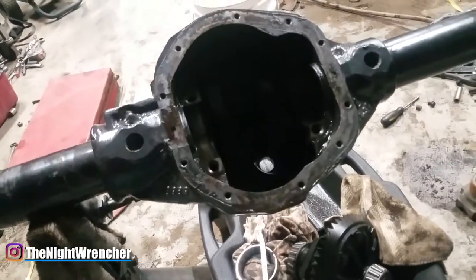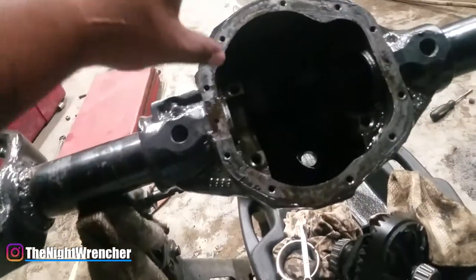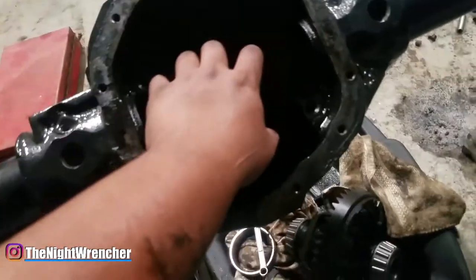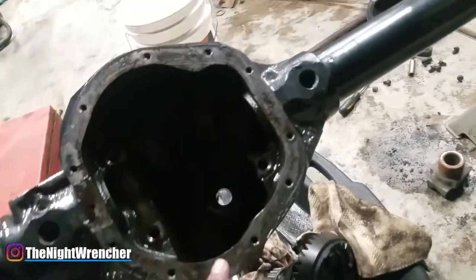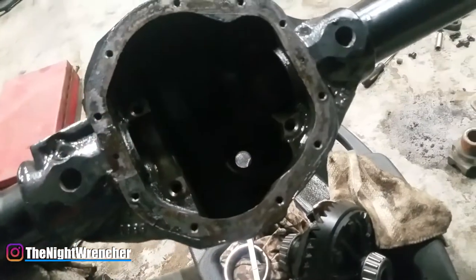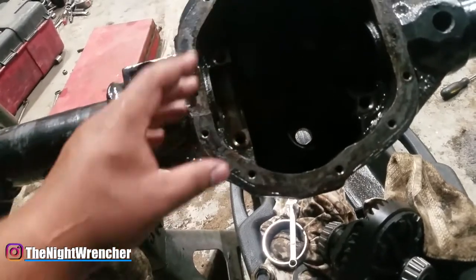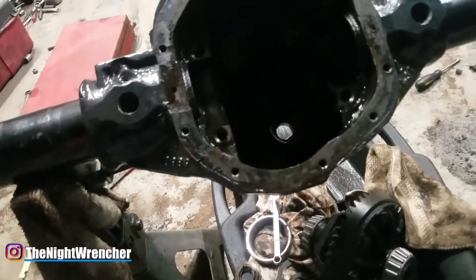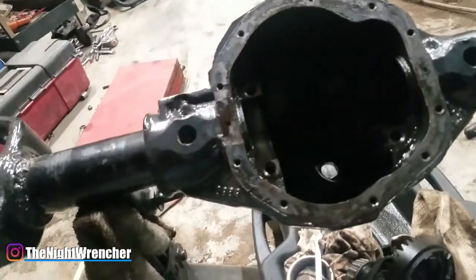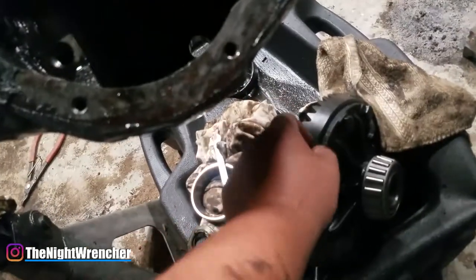If you install the wrong gears in the wrong carrier, you're going to install your pinion and they're not going to have any contact whatsoever. I tried installing shims all on one side to bring the carrier closer, but it only gets to a point and then it's just impossible — there's no way to get it close enough to get a good contact surface.